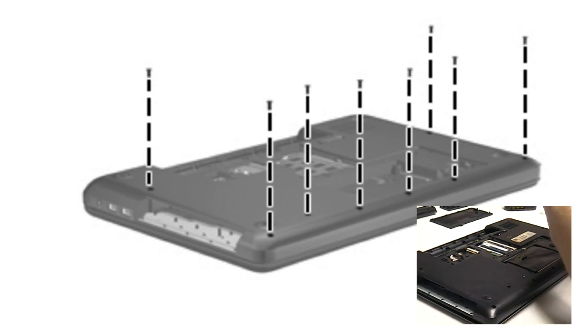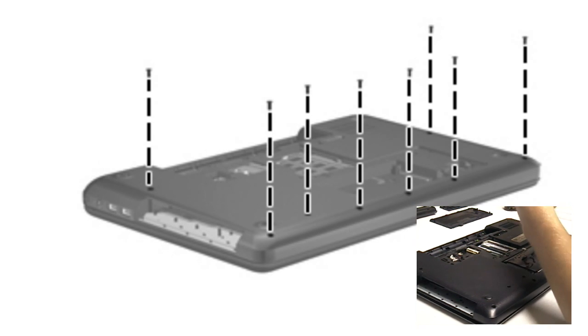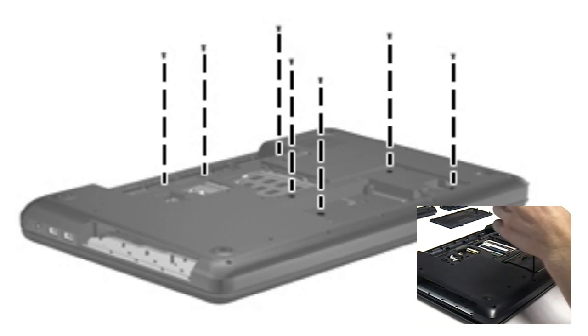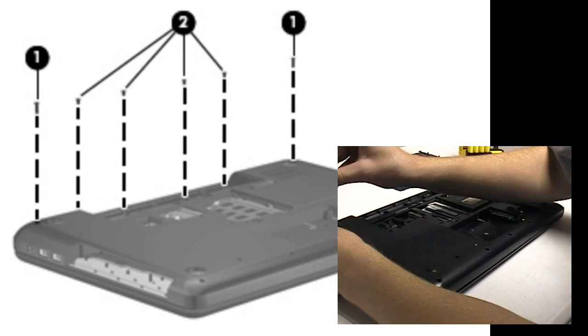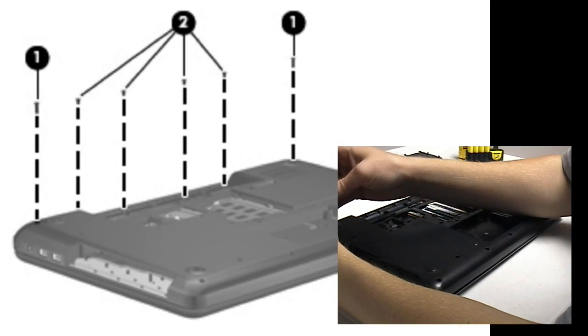Step four is removing the top cover, that is the palm rest. This is probably where the real meat of the disassembly starts to take place. I've got a picture from the service guide showing the screws you need to remove. In the video I'm removing the screws holding in the hard drive — even though the guide doesn't say to remove it, you do need to because there are screws holding the palm rest underneath it. After those, there are a handful more screws to remove to unsnap the palm rest. If I'm going too fast, there's a PDF link to the service guide in the resources section. The screws marked one are a little longer and those marked two are significantly smaller, so they can all go in the next slot up on the screw tray.